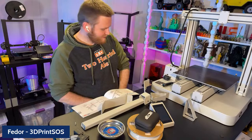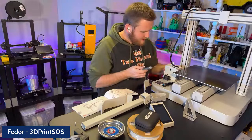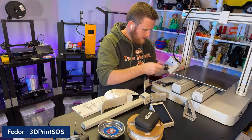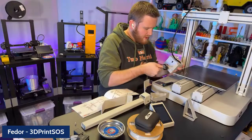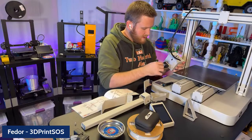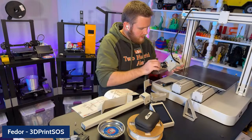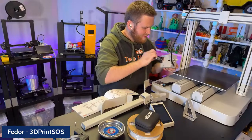Off with the 10 mil. You can never find the 10 mils. You just got to buy new ones. I know that all too well. All right, let's see. It's going through nice and clean. So it looks like it must have just caught some kind of burr on the way out when they took it apart. Yeah, no resistance. All right, that's good, right? And yeah, there's going to be some metal shavings. Let me take off this little T-handle.